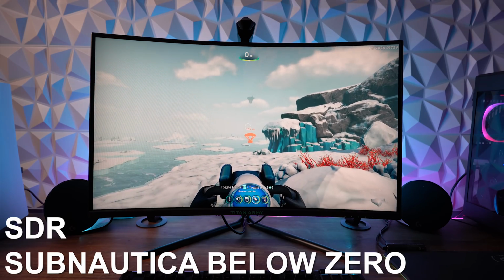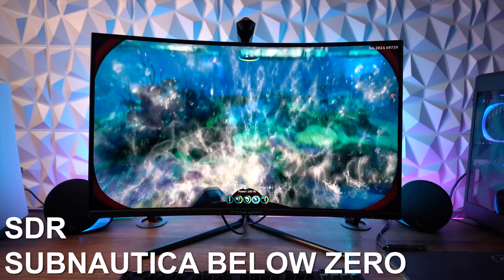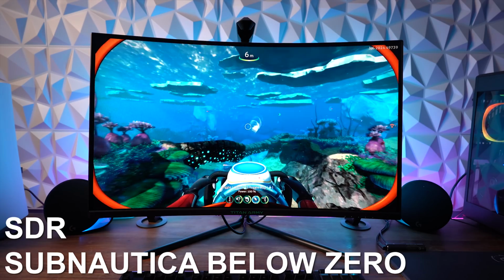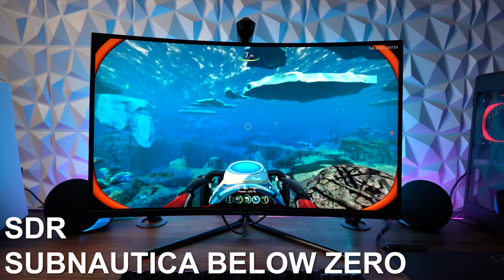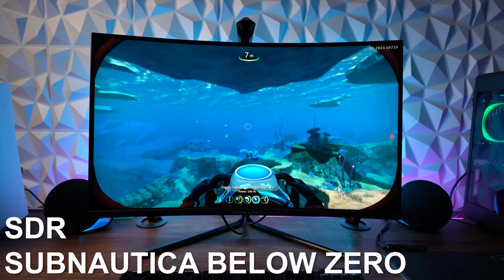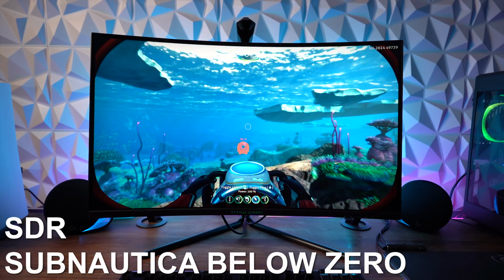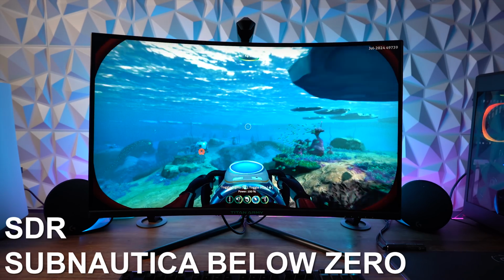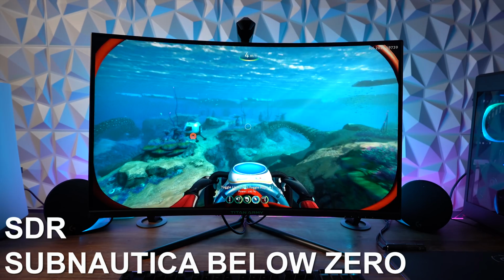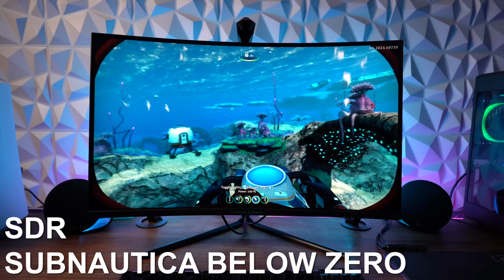And paired with that is the 240 Hertz, which at this price point is a solid deal. The thing that kind of draws this back though is it does have a slower response time. So this is going to lead to more visible ghosting when you're looking at a UFO test. How much that's going to translate to a game and how much you're going to notice is actually just dependent upon the person. So some people may notice it more, some people may not notice at all.